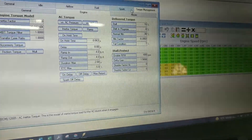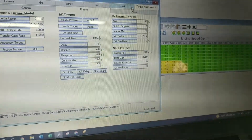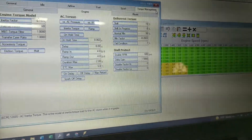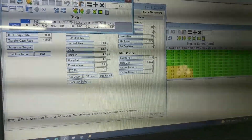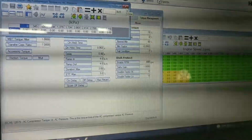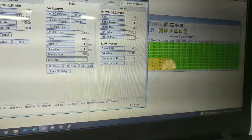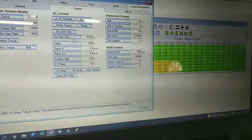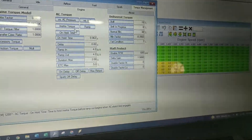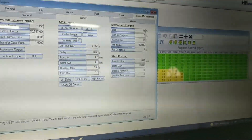You can't just hook 12 volts from the compressor to the ECM — you also have to put that ground in. If you have a truck computer, Firebird and Camaros also use AC pressure. It depends on what kind of operating system you have, so check into that. Eliminate the AC torque max retard timing table — set it all to zero — and then it should work. When you kick the AC on, it bumps the idle up, and nice things like your fan will kick on.